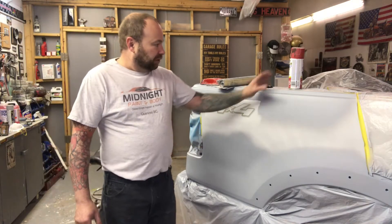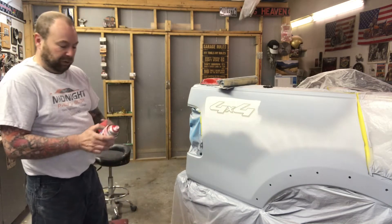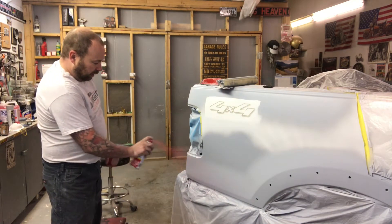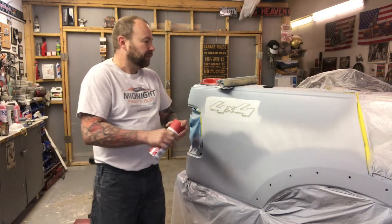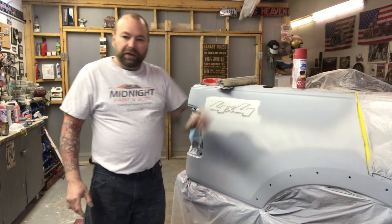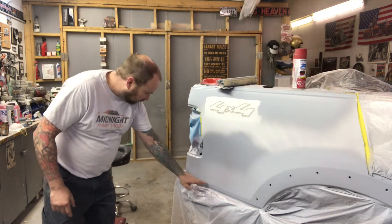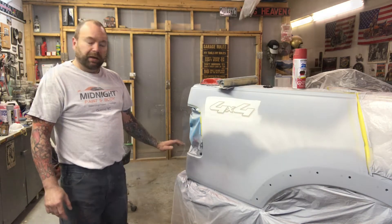I'm going to show you a little tip before you get started. This is something everyone has — lots of these old spray cans around. If you want a bit of a guide coat, see this is where we did the repair, you can just mist on a quick little blast of spray paint and that's going to give you a bit of a guide coat when you start blocking. It's going to show up any highs or lows, or in this case it has a body line we need to make sure is nice and straight.